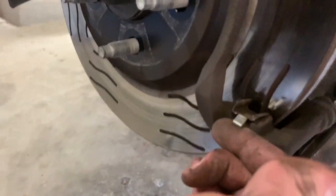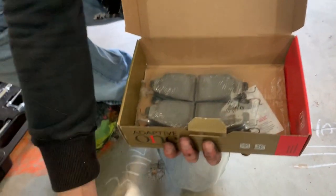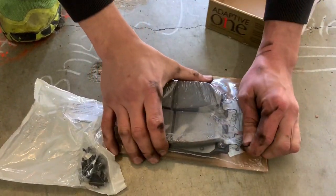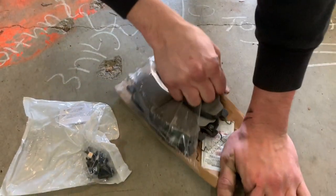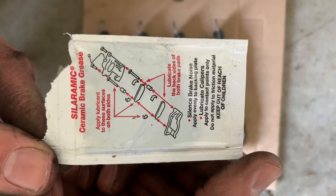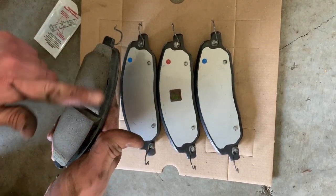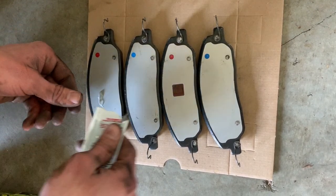Make sure you pop these clips off because your kit should come with new ones. Here are the clips — clip-a-roons — and then you've got your new pads right here. Fresh, brand new. It comes with grease too. You're going to want to grease your ceramic brakes at the clip contact points. Don't grease any of the friction surface — you will literally die, your brakes will not work, and you will hit a wall. So just put a little bit of grease on the clip action points.